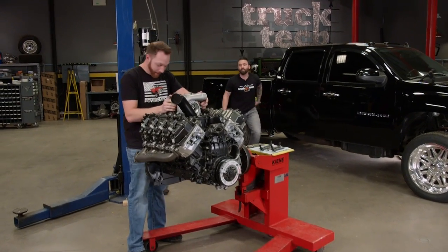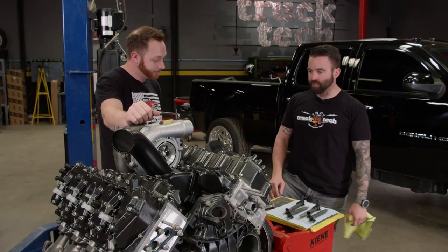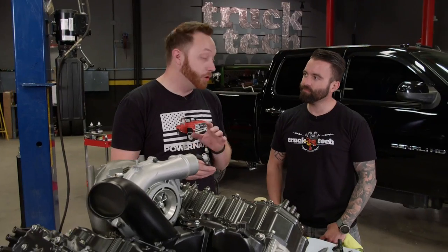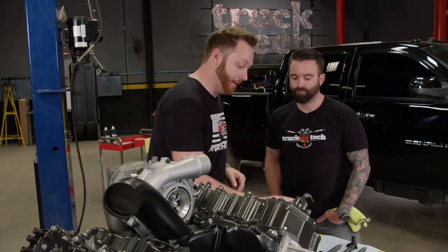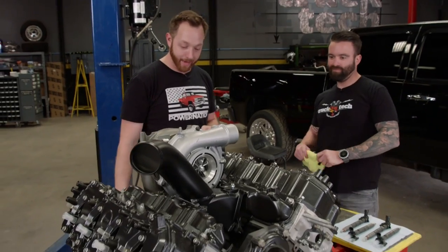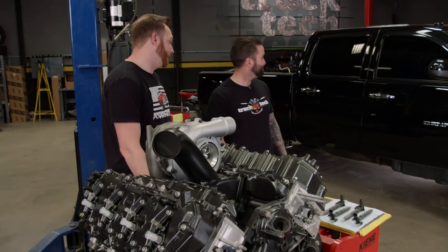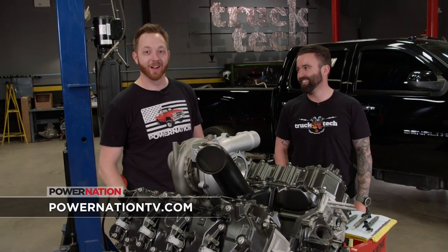Looks like you got that looking like a complete engine. Yeah, the long block's pretty much done — got the whole valve train in, valve lash set, pushrods are in, basically ready to run. We picked up these injectors from Summit Racing, made by Dynomite Diesel Products, and they'll flow enough fuel to support 1,000 horsepower — that magic number we're shooting for. They've also been balanced to within 2% of each other, so we'll have a nice smooth-running engine where each cylinder contributes exactly the same amount of power. That big 67mm turbo looks beautiful sitting in the valley too. We've still got some work ahead of us — if you have any questions about anything you've seen on the show today, check us out at PowerNationTV.com. Thanks for watching, catch us next week.